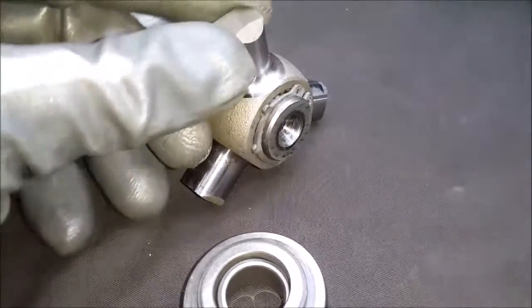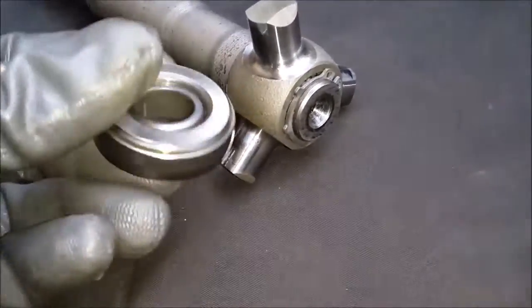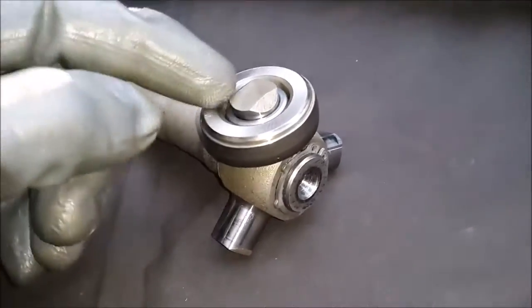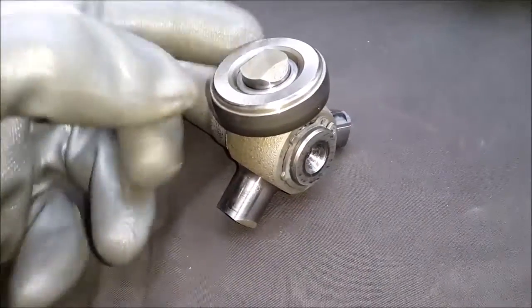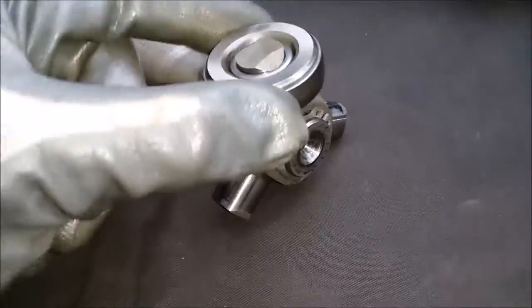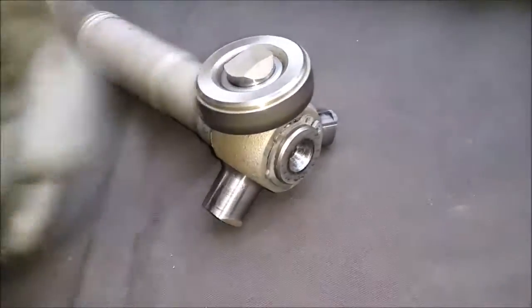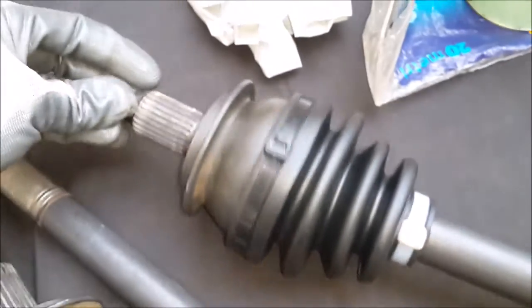In the case of Juliet, her roller bearings go on this way and they don't have any locking pins. Once the shaft is in the joint they cannot come out — the cup will be holding them, so there'll be no way for the rollers to escape. And that's pretty much it. Here's the assembled joint, nice and smooth, with new fresh boots both inboard and outboard.